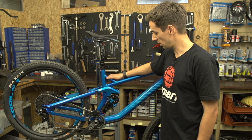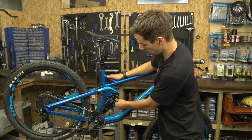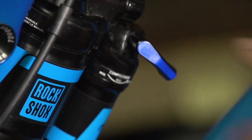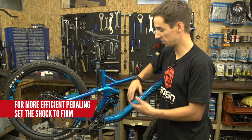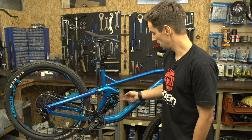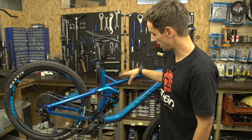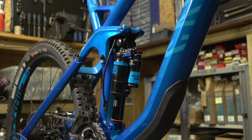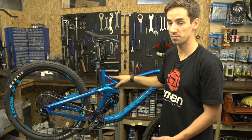Finally, a lot of shocks now have extra technology that can really help you out. This RockShox Monarch has a lockout lever that goes from open to middle to firm — the firmer you have it, the better the bike will pedal and it won't bob around as much. That's really good for long climbs; you can whack it all the way to locked. Sometimes you can have that mounted on the handlebars so you don't have to reach down. My Canyon Strive also has shape-shifter technology that moves the geometry from steep, which is good for climbing, to slack, which is much better for descending.